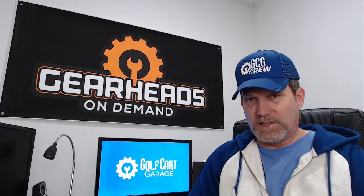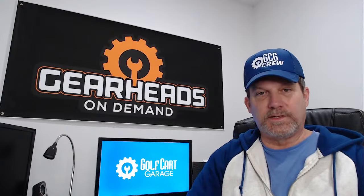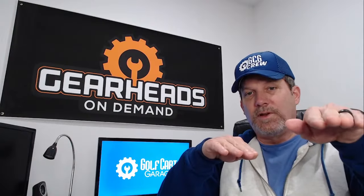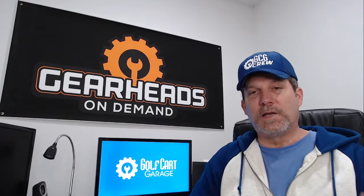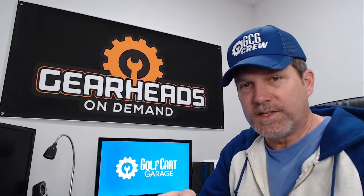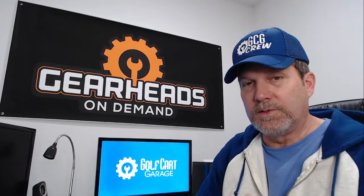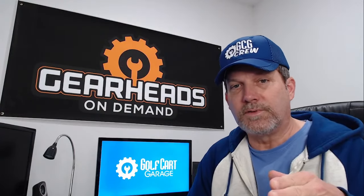Or you could check your front shocks for sag. A G16 is an older golf cart, so are you sure your front shocks aren't sagging some? They could be lower. It might just take replacing your front shocks to raise the front up a little bit — just replacing them with new ones. Over time, the front end of any golf cart ends up sagging and gets a little bit lower. A lot of times you'll look at a golf cart from the rear and it's leaning to the driver's side because it spent a lot of time with one person on that side, and those springs on that side get a little weak. So you might think about just replacing your front shocks and see if it raises the front up to make it even.